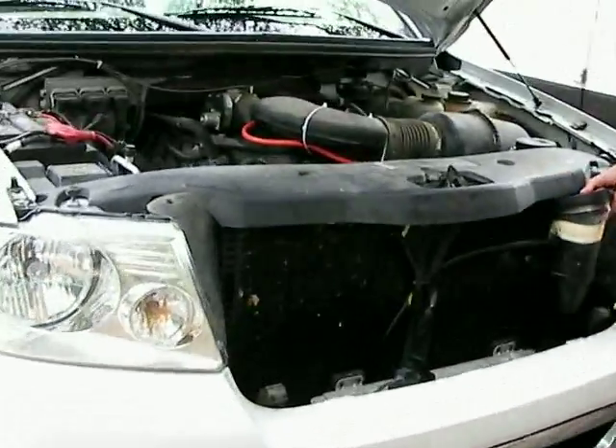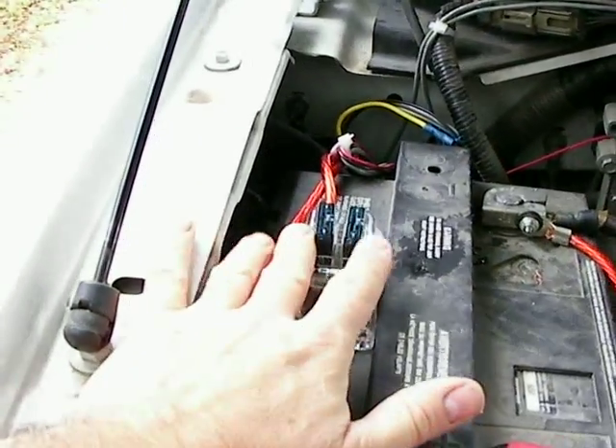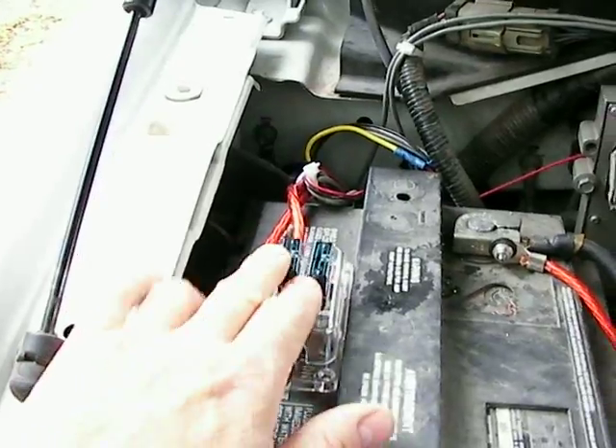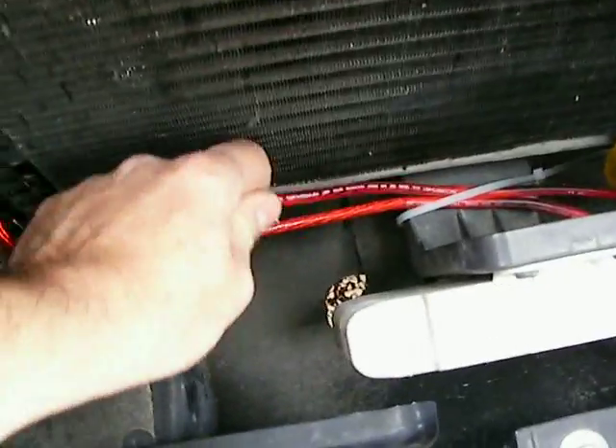He came in this morning because we're having some problems with the fuses. My plan is to split the fuses, use two relays, and double the wire going in here, because everything is getting a bit hot — the wires are getting a little warm with 54 amps.